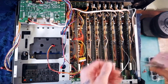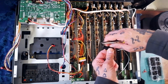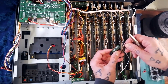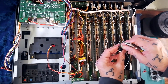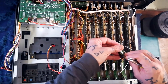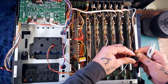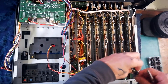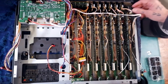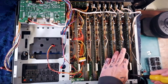Hopefully you can see the serrations on the end of that jack socket. When you put it back in it's quite fiddly, but you've got to get that socket hard up against the chassis so you can then push the clip in. There are like four different serrations you can go into — you want it to go as far back as possible so it's relatively tight. Then there's a plug at the far end connecting each board to the little daughter board with the input sockets.